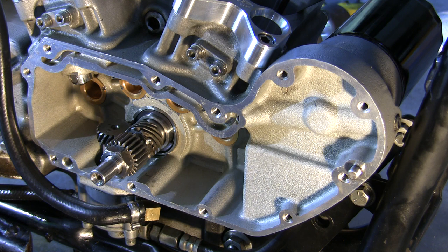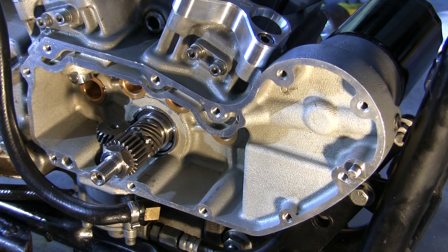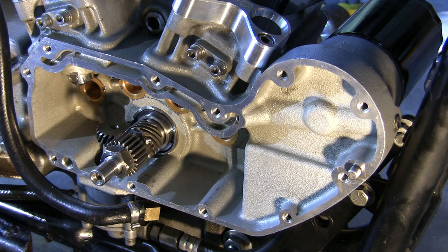Even though I'm running it in the Super Street class in AMRA. I've got the cams and the cam cover sitting here with the gasket ready to go in. I've greased the bushings — put a little builder's grease on there for insurance upon startup. This motor is running 600-lift Hammer cams. It's got the BFH Hammer heads where they change the valve angle, so it can only run 600-lift cams. But along with the S&S .725 roller rockers, it gives about 640 lift. They have bigger valves in them, so they breathe just about as good as if you had a 700-plus lift cam.